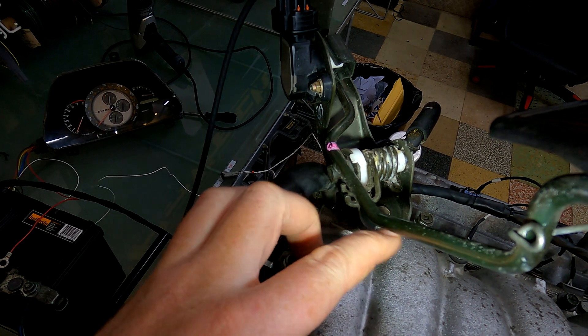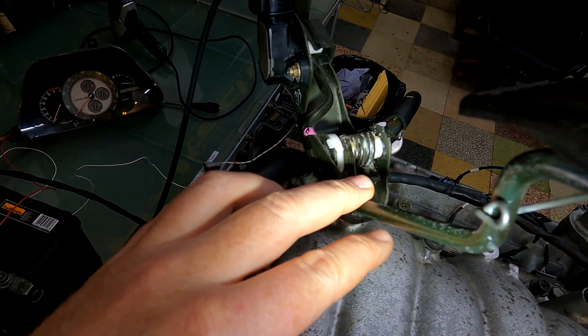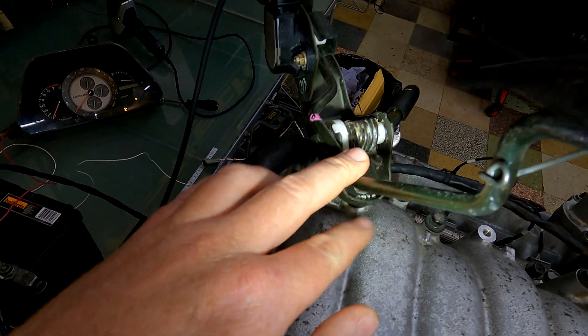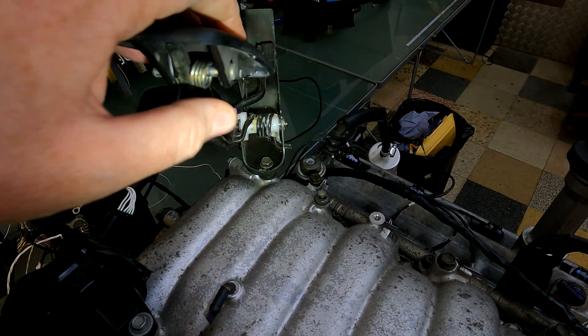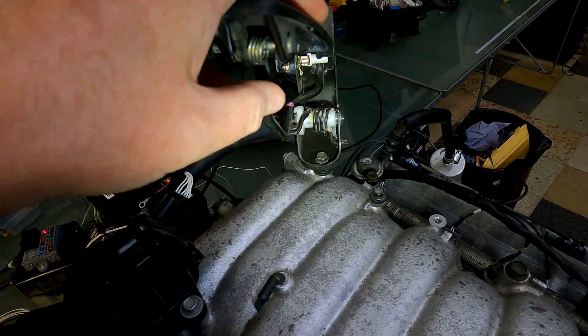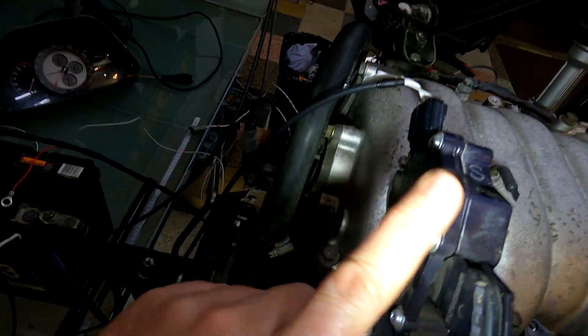I don't really like to use these for swaps because of that. The problem is if you don't have TunerStudio or a similar tool available to see the exact point at which it cuts out, you kind of have to put a stopper and just keep adjusting it millimeter by millimeter. Plus you've also got to account for someone slamming their foot to the floor, because the last thing you want is for your throttle to shut down at full throttle.